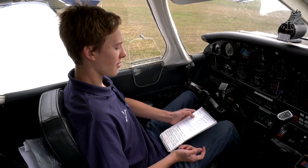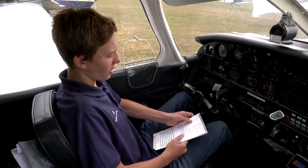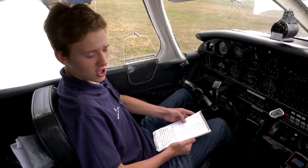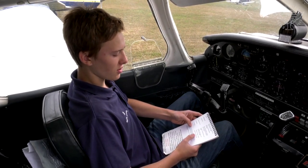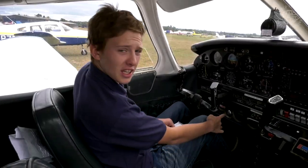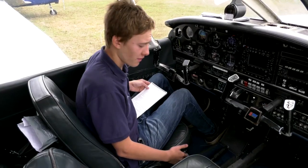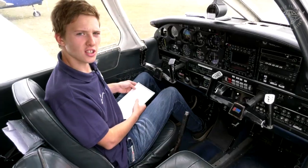Check that you have a chart, as these are required by law to fly in the UK, and check you have all your computers and navigation equipment. If you're going cross-country you'll also need your survival gear, and check whether you've filed a flight plan if flying VFR or if you're booked out. Now check the magnetos are off — the selector should be pointing to off and the keys should be out. Then put the flaps fully down by pulling the lever three clicks so they extend fully.